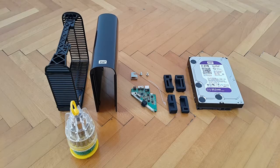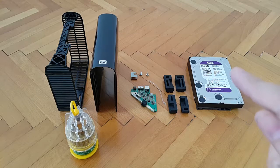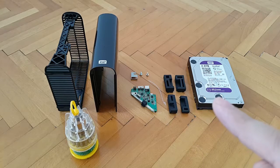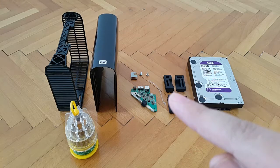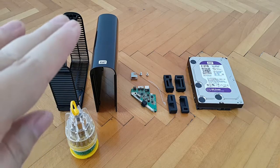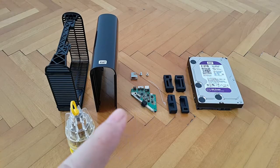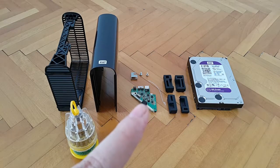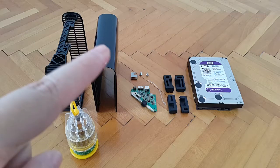In this video I'll be fitting this hard drive into this enclosure. I'll be attaching the four rubber feet to the ends of the hard drive, and prior to that I'll be attaching the controller onto it with the two allotted screws and this metallic piece. Then I'll insert the hard drive into the main body of the enclosure and reattach this transparent piece of plastic, which is used for drive activity indication — there's an SMD white light underneath the rubber part on the controller, and the transparent piece brings that indication to the front of the enclosure mask.